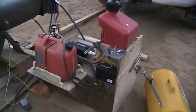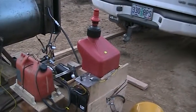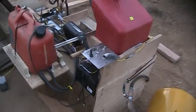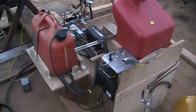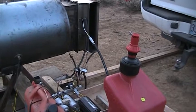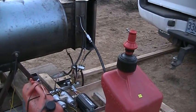Looks like I've got my spark on — turn that off. This is a lot of jerry-rigged looking stuff here, and of course it won't be on the real McCoy. The fuel tanks there — the truck that this is going in will have the fuel come from its own fuel tank. The pumps will be all nice and neat. All the wiring is just jerry-rigged so I can fire up pumps and turn off things at different times to feed it the kind of fuel I want. There won't be any rubber lines like that on the real engine, because when you run pressure through them and turn it off, the lines balloon a little bit and put more fuel in.